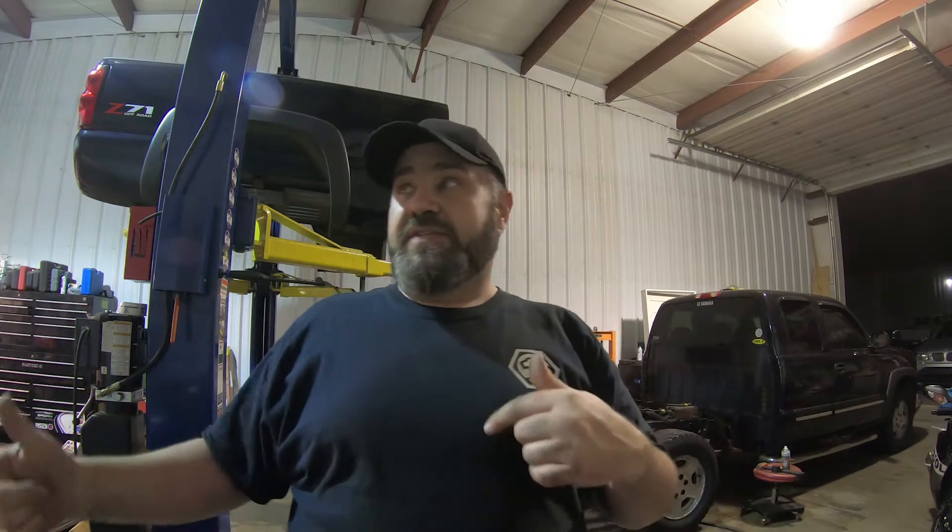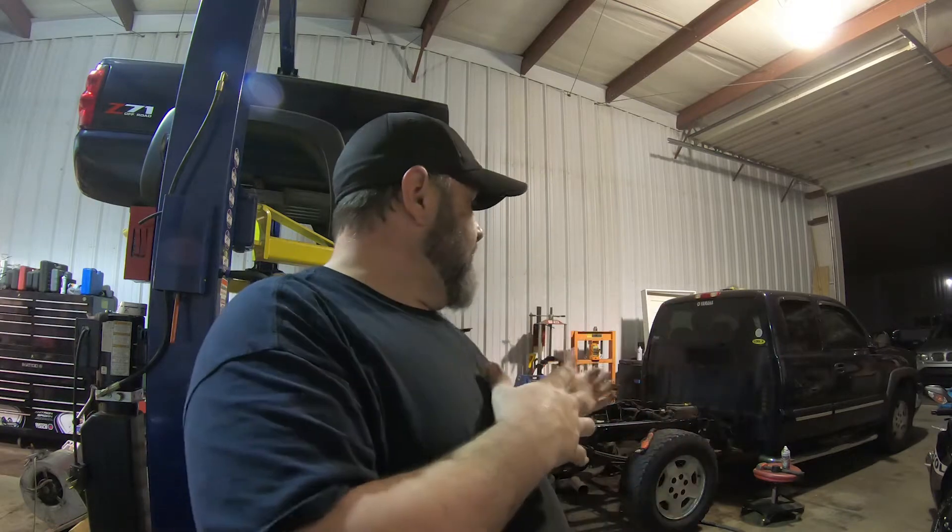What's going on everybody - it's the next day for you guys but same day for me. As you can see behind me, we got all the frame done, all the cross members installed, everything tidied up and painted. We put a nice coat of self-etching primer on it, descaled the entire frame, shot the primer over most of the frame and the rear section, and then shot a coat of flat black frame paint. That'll give the customer the ability to throw any kind of por-15 or anything else on top since it's already been pre-etched.